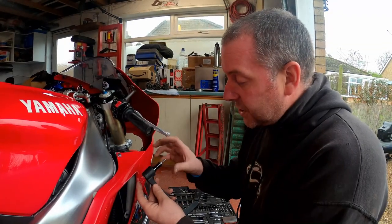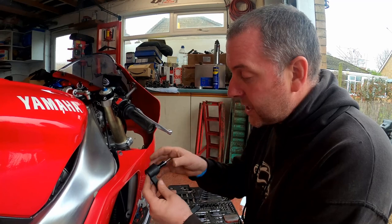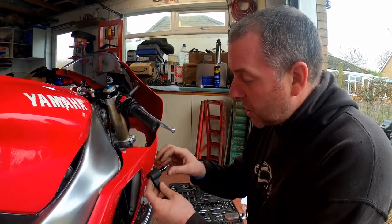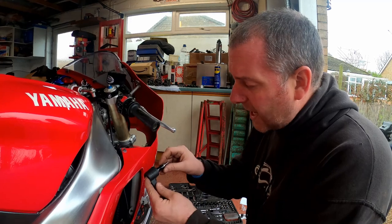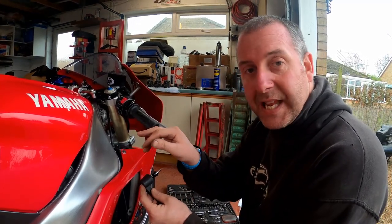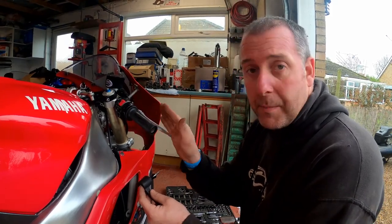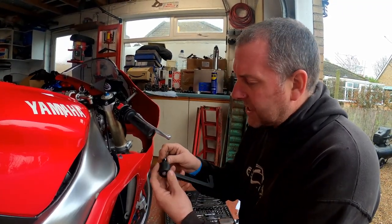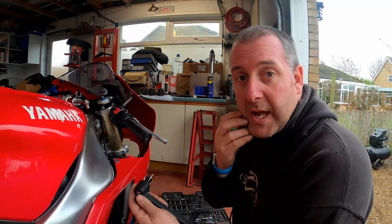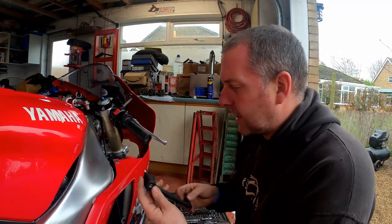As you can see, what I've done is pre-assembled the hardware required for this bar onto the bolt. And I've expanded it enough so that it fits snugly in the hole further up the tube — because if it doesn't, all that'll happen is as I try to tighten it, the whole lot will spin and we won't achieve anything. So it's ready to fit.